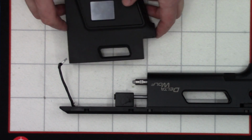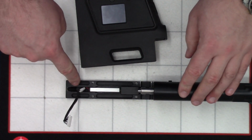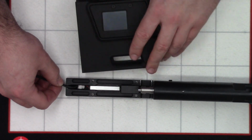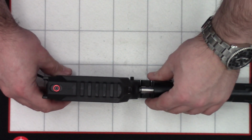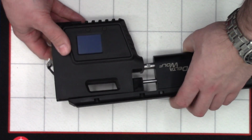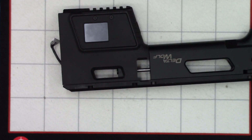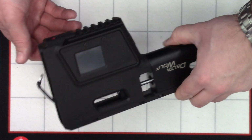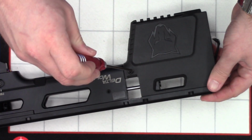And then quite simply to put it back on, what we have to do, flip it over. See the wire in here, we're just going to push that down into the cutout so it doesn't get pinched. Put the top piece, or the back piece, on and slide it forward. Like so. The wire is nice and free, it's not pinched or anything like that. So from this side, what we can do, do this grub screw up